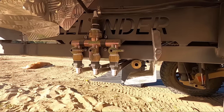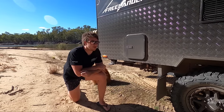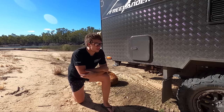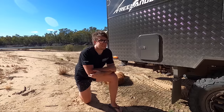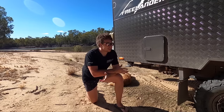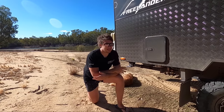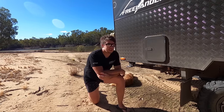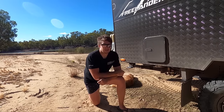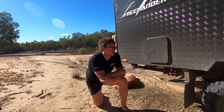Down along here we've got our isolator taps. We've got three tanks on board — two 90 litres and a 60 litre. We decided the 60 litre, which was originally your grey water tank, to just have that as fresh water. We did our three-month trip last year and there's really only one place we actually needed grey water, so we ended up wanting a bit more fresh water on board. You can draw from one tank at a time so there are no air blocks.